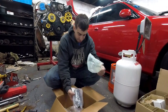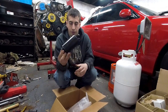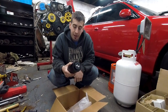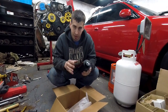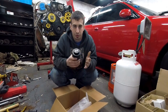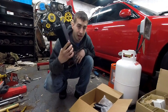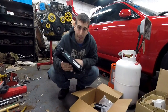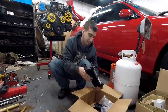Got a lot of unnecessary bubble wrap. I got a bracket in here and I got a reservoir for the power steering fluid. You can use the stock reservoir on the 240s, but they are known to leak — even without a swap, just with a KA or SR motor, they just leak a lot. So I might as well just buy the kit with this. I'm going to start installing parts. I'm not going to install the cooler yet because I don't have my bumper installed — I have to wait so I can see exactly where the best placement is.